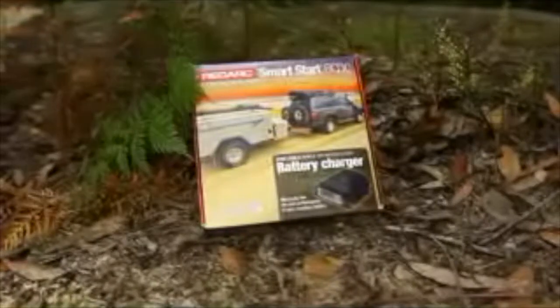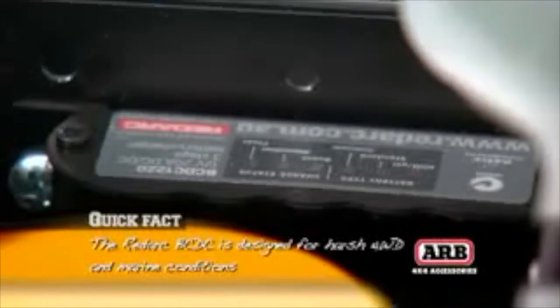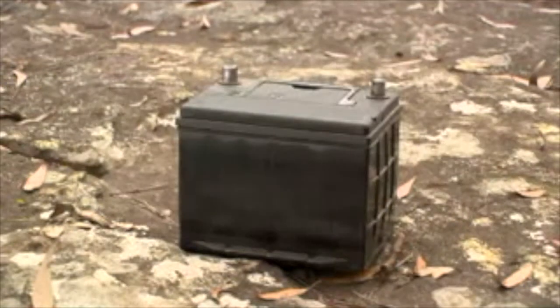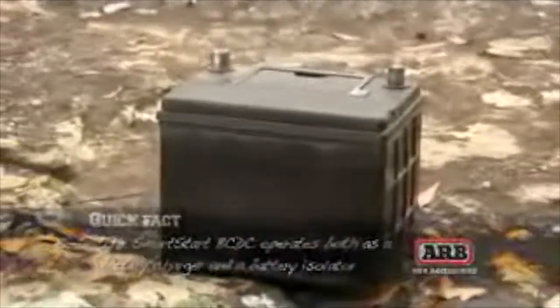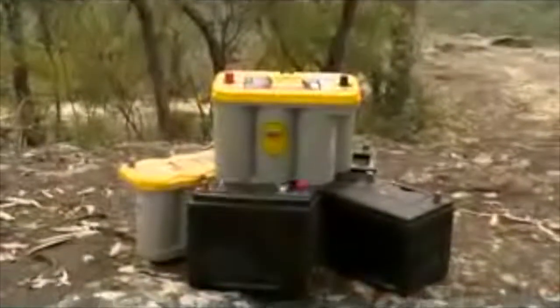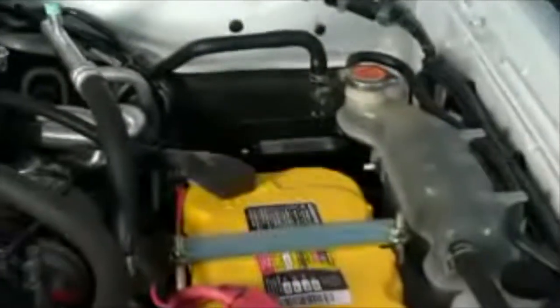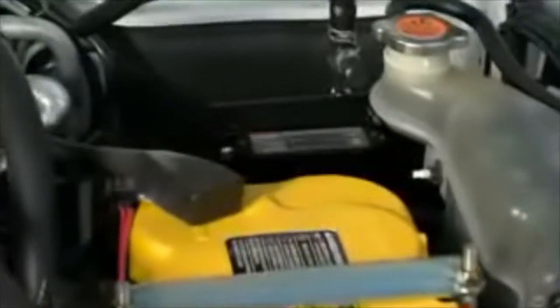So what's the answer? How do you do it? Well with one of these — it's called the Redarc BC-DC — and this is a battery charger unlike any other. The BC-DC actually works out the type of battery that you have in your vehicle, so if it's an AGM or a gel battery it'll tell you. If it's a standard battery it knows that as well, or a calcium battery, and then it actually adjusts the type of charge to suit that particular battery. For example, your calcium battery needs a whole lot of power and it needs it fast, whereas your other batteries, if you charge them too fast they'll heat up and you'll have other longevity problems. So this is basically the brains of the unit — the BC-DC works it all out for you: how much charge each battery should have and exactly what sort of battery it is.